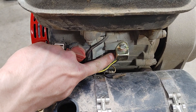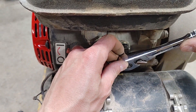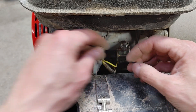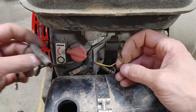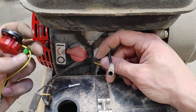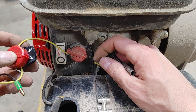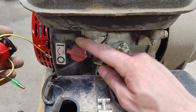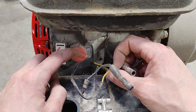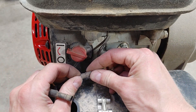There's a little tab on this side right there. I'm just trying to get it on that side of the tab so I can tighten this down correctly. So that one is hooked up. This one would go here — the black goes to this one. We've got an extra wire that's not on this, unless it's behind there. Since this is most likely just the switch, we can hook everything back up and see if we get spark again, to see if it was just this guy.